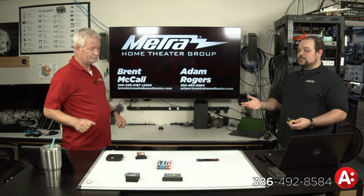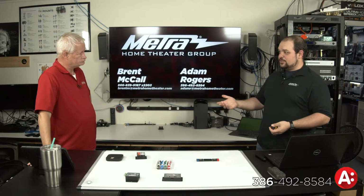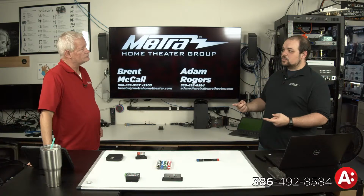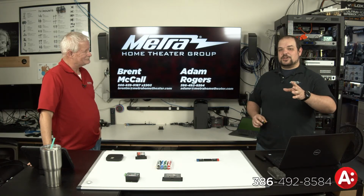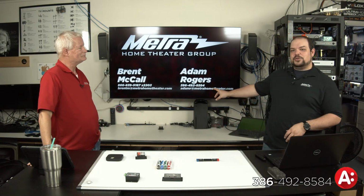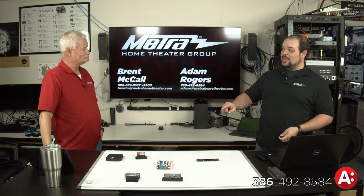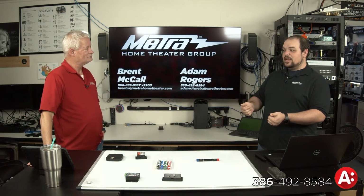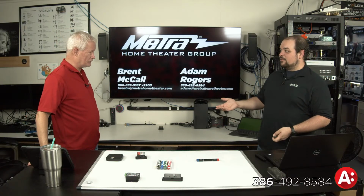Right. Now, of course, the Xbox is a little bit more advanced than a lot of other types of devices, and it does have a feature where, if you're having problems with the video output, it goes into safe mode. You can actually force your Xbox to go into safe mode by holding down, I believe, the eject button and the power button when you first turn it on, which resets the video settings down to 480p. Because the thought is that maybe you connected it to a TV and set something at a super high resolution that it's not actually capable of. So it gives you a place to start again.